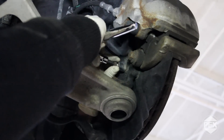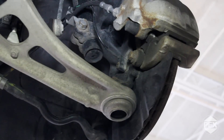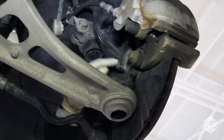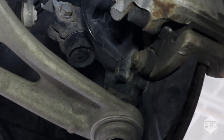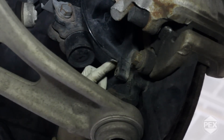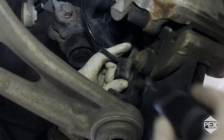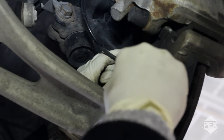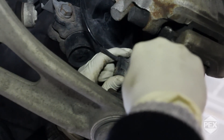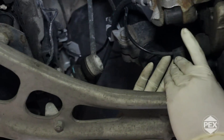It's just a screw, no washer on there. Next thing we're going to do is remove the sensor body from the carrier, from the knuckle. What tends to happen is if corrosion builds up here it'll be frozen, and you may want to get a flathead in there and pry it out — sometimes it'll fight you a little bit. This one seems to be coming right out.